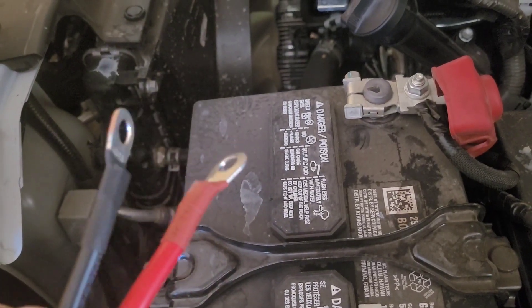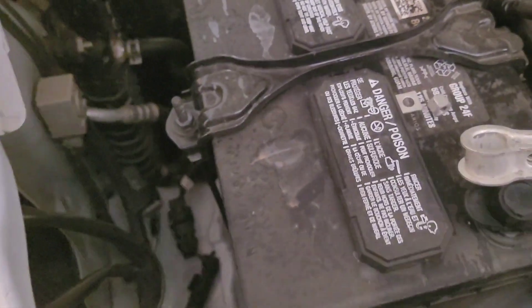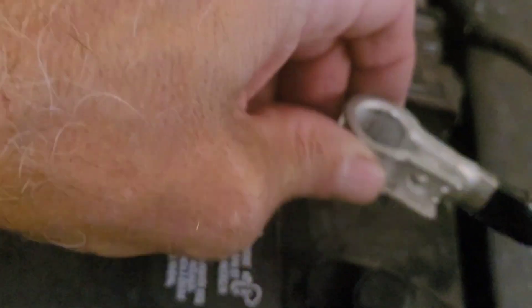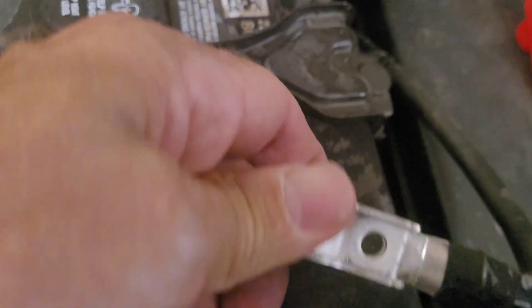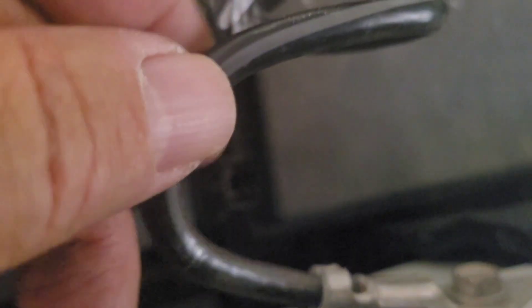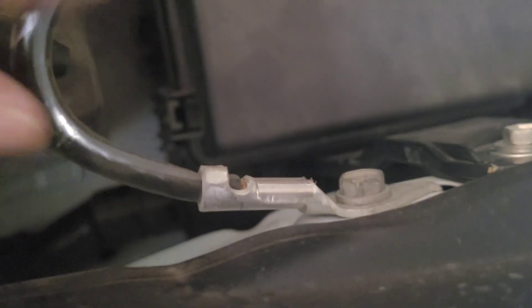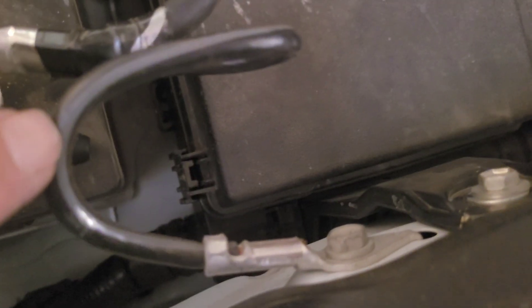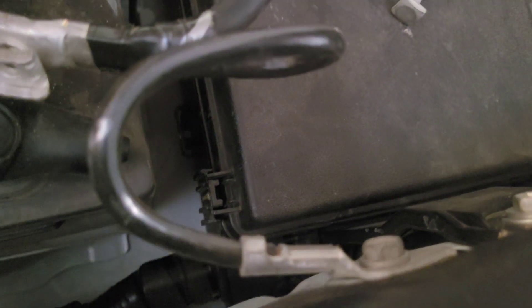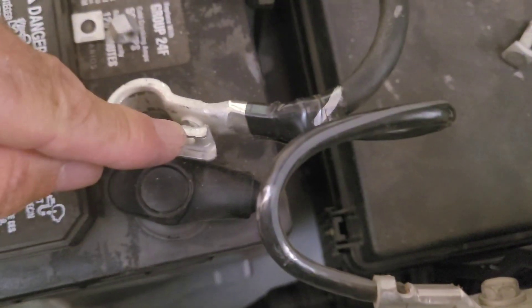You're supposed to hook up these terminals to the positive and negative battery terminals, but unfortunately the negative battery terminal is too narrow and only has this one joint. So I'm looking at filing the lug down to connect directly to the battery terminal. Otherwise I'd have to go on the thinner chassis return cable, which can't handle 500 watts — that's around 35 amps — which is too much for that one small cable.